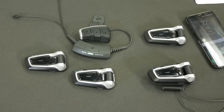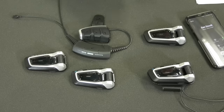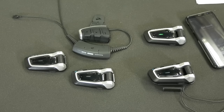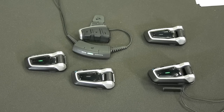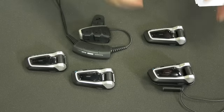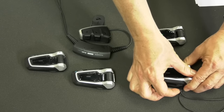Please note that a bridged unit needs to be in close proximity — bridging works best in a rider-to-passenger scenario. Now let's explore some tips to enhance your group intercom experience. Got a long-lost pal calling? Answer and share that active phone call with the rest of the group — just press the intercom button while the call is active. Like to have a private chat with a particular member? Select that member through the Cardo Connect app first, then double-click the intercom button to toggle between private and group chats. Want some peace and quiet from the chatter? Click the roller for two seconds to enjoy an intercom-free ride. Click the roller again for two seconds to unmute the group.